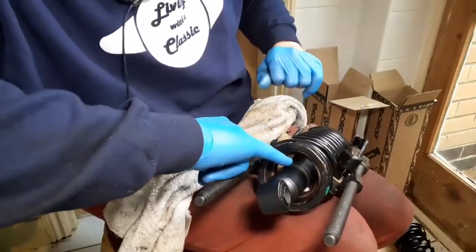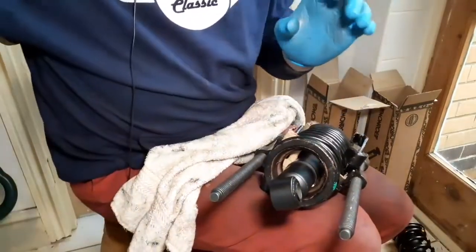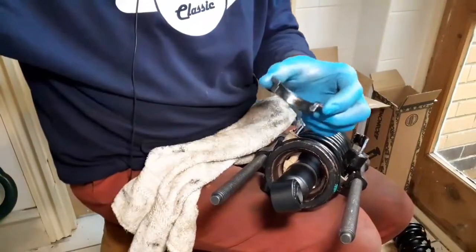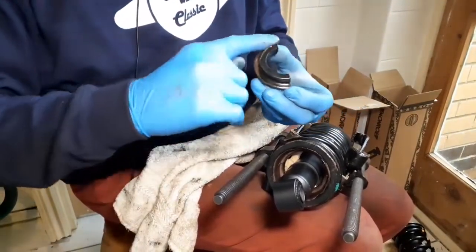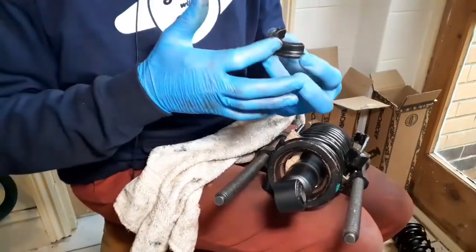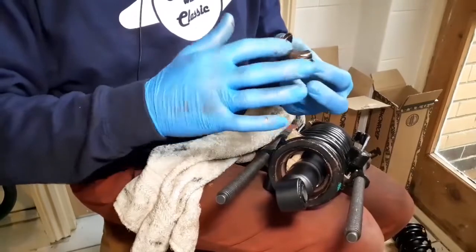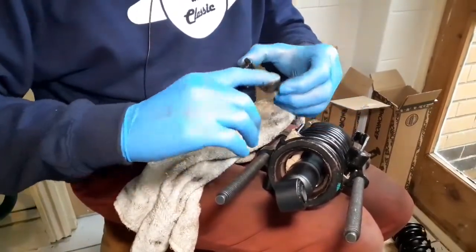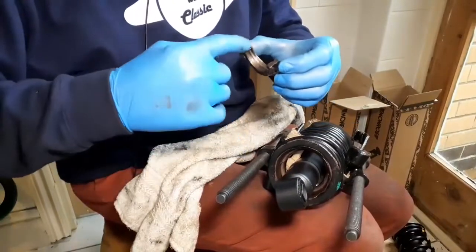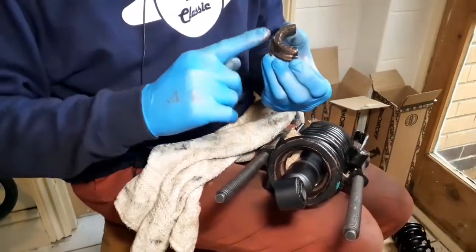There's a lip inside there. It just sits over that lip. Now we'll take one of the collets. I'm going to put plenty of copper grease on this too. I don't want any seizures in the future. Who knows if I have to take these out again, but I don't want any sort of seizures. They were a complete nightmare to remove because they were fitted in the factory clean without, they were just shoved in. They weren't covered in copper grease.